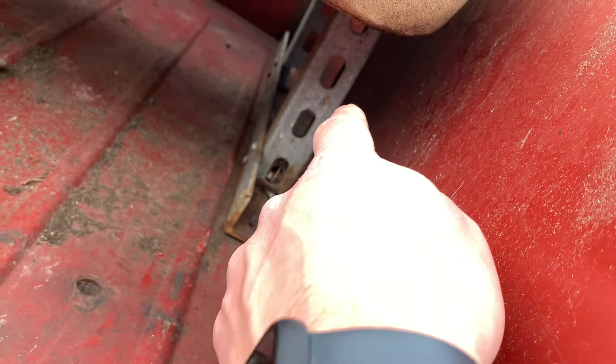Here is why we're doing what we're doing. This is the Jeep I picked up a few videos back and it is rotten — really, really bad shape from here back. But the good thing is it has the drivetrain: it has a T-150, Dana 20, and the 258 straight six. It is all completely there. When we went to pick this up, I turned the fan and the crank — the crank pulley is not locked up. So the engine, fingers crossed, should fire up. But it hasn't fired for a while. There's some gunk down in the carburetor. I've got to clean that out, pull that off the base, suck that out of the intake manifold, and see if we've got any stuck valves. We'll fire this up in another video.